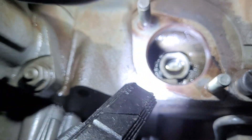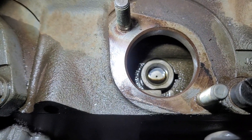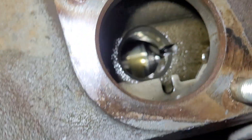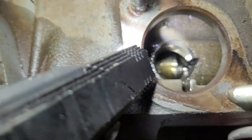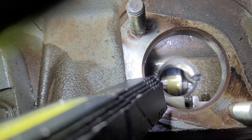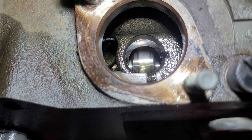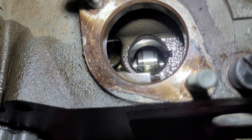Now I'm going to remove the tappet and check the camshaft position for this unit injector before putting on the new one. Here is the tappet for the unit injector and the camshaft. Right now the camshaft lobe is not all the way up, so let's turn the crankshaft. Once it's all the way up, put the tappet back. Let's turn the crankshaft - I'll show you as I turn it. Check the lobe on the camshaft and make sure the lobe is all the way up pointing toward the tappet.